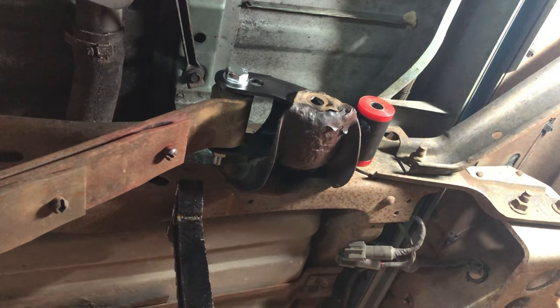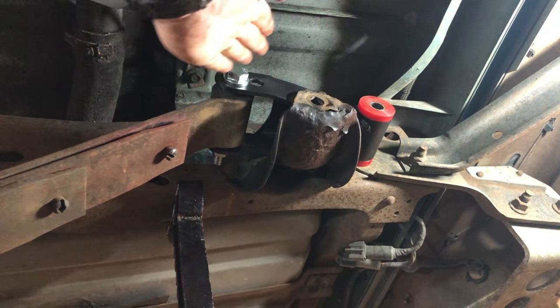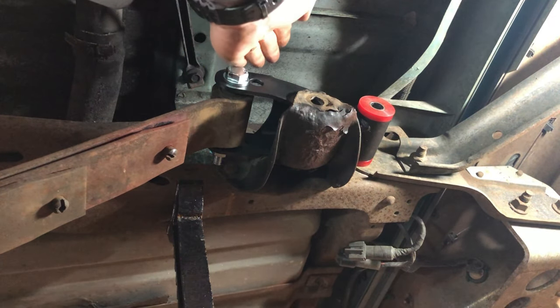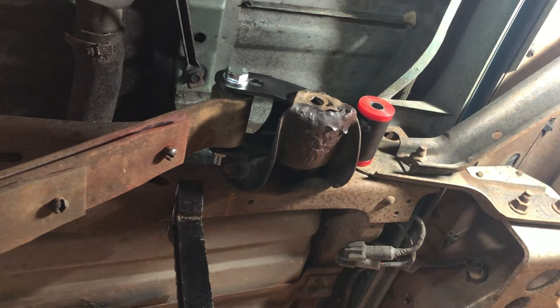So now, hop over here and jack up the axle. Jack up the axle or the truck? We want to raise this axle so it pushes this spring up, and we can turn this shackle to go in. So pull the jack off? Pull the jack off these blocks. Oh, you pull the jack off the block. Is that what you want?